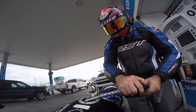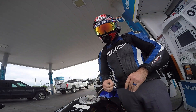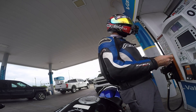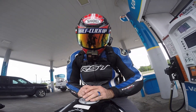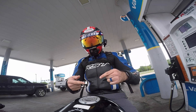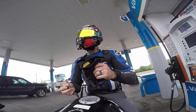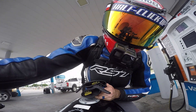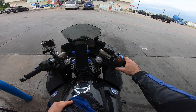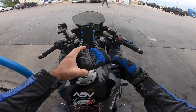That generation of Tiger, as well as all the other bikes that starter came on — including the Speed Triples from about 2010 to 2014 — they are notorious for generating a bad case of heat soak. What happens, as I understand it, is the armature insulation inside the starter degrades to such a point that the starter can't even be rebuilt. New brushes won't do a thing. It acts like the battery's bad, but I know it's a good battery. The voltage drops dramatically — a classic indication of starter failure on those bikes.